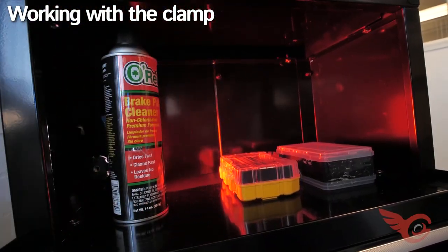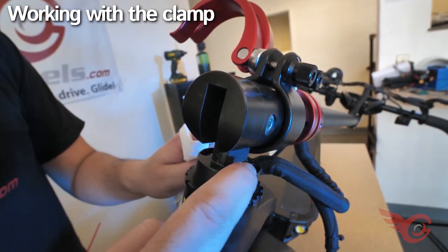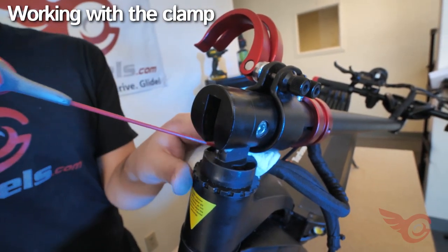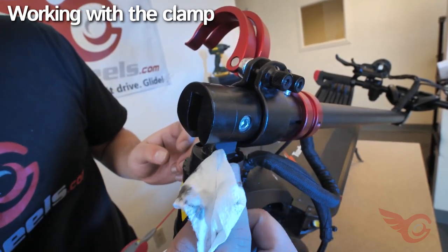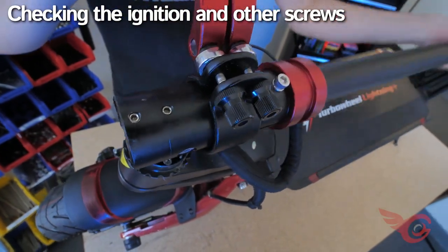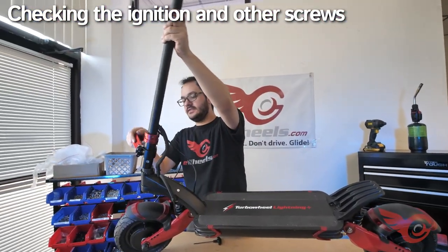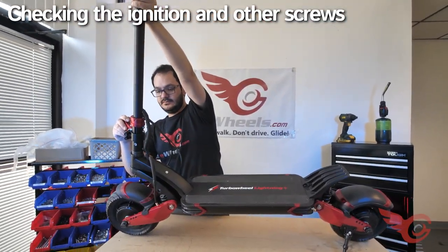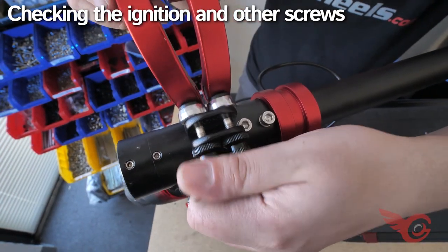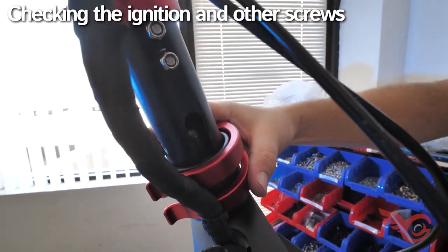Here are some tips to help with common clamp problems. Applying some lubrication to these areas helps with squeaking, reducing wear, and reducing stickiness of the elbow action. The two grub screws in the front and bottom of the stem determine the angle of the stem — tighten the screws to increase the angle, or loosen the screws for the stem to be more vertical. Screwing in the nut on the other side of the latch will tighten the latch and the lock, keeping the stem steady.